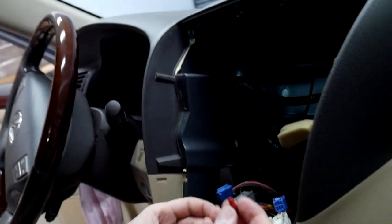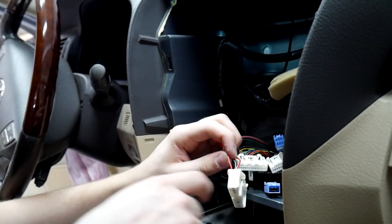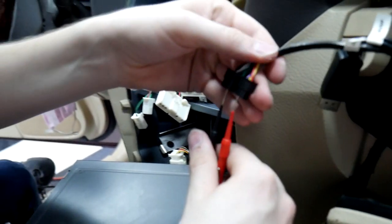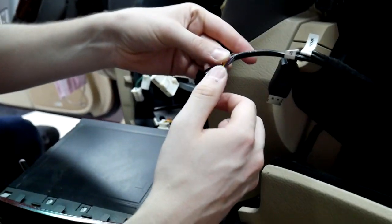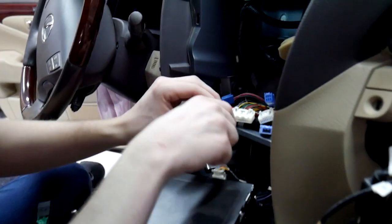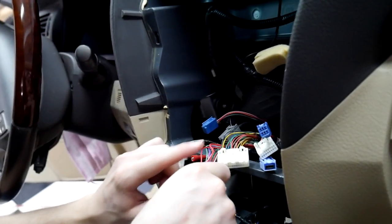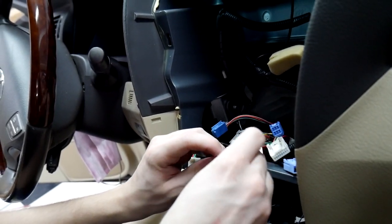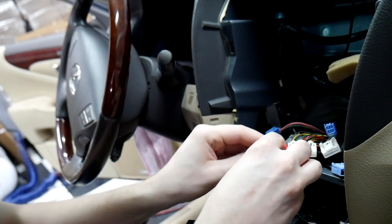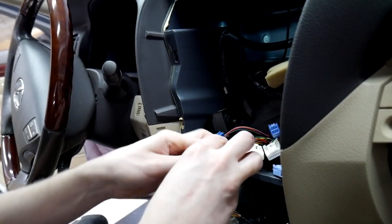One quick tip when using the p-tap: sometimes it might not actually make a full connection, so it's something to look out for. We tested this wire from the 20-pin harness — the purple wire is your reverse signal. When I checked it against ground, I was getting zero volts. We pulled it apart and found the p-tap went through the shielding but didn't go all the way through to the wire. We're going to attempt that one more time and test it. If you have any issues with the reverse camera line popping up on screen, double-check that reverse wire.